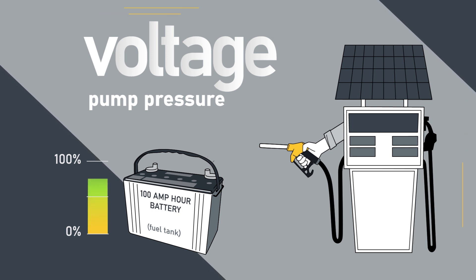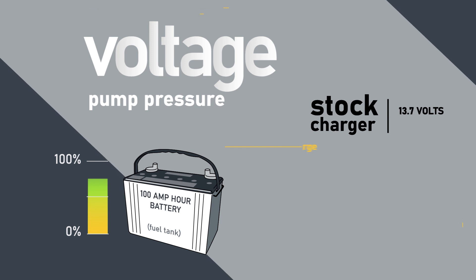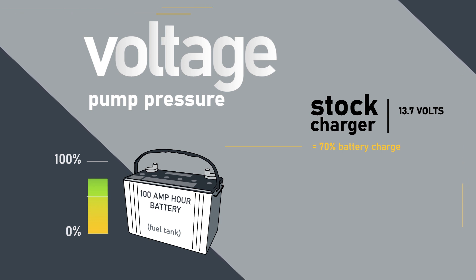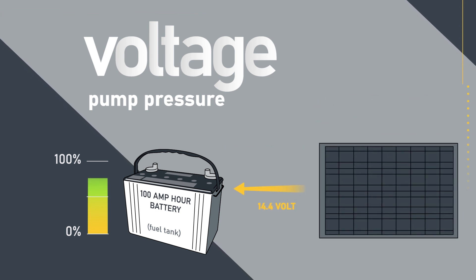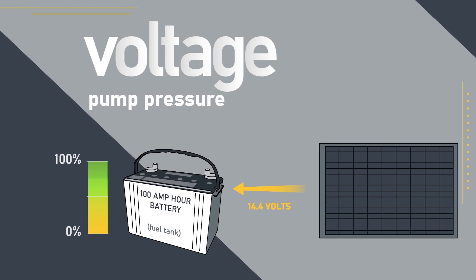When your batteries are depleted or your gas tank is empty, you plug in for a recharge. Most RVs come equipped with a charger, but most stock chargers don't quite have the power to get your batteries or gas tank 100% full, which means you can't go as far on your next trip. This is why a lot of people go back to the RV dealer and ask what's wrong with my batteries — I can't stay out as long as I did the first time. Every battery type has an ideal level of full. Most batteries can be recharged to a voltage of 14.4. Make sure you check the label on your batteries to ensure your charger is set to refill them correctly and get as much power out of them as you can.